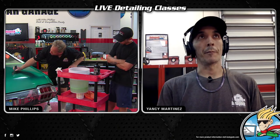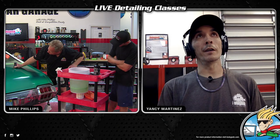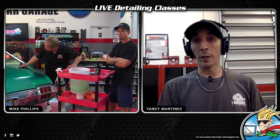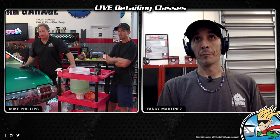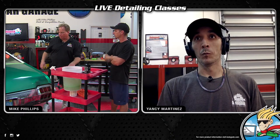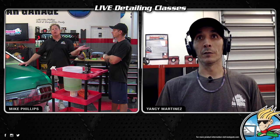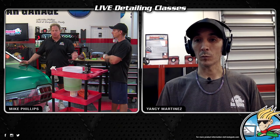8.1, 8.7, 10.2. Well, let's put it this way. If the average clear coat is 2 mils at the minimum. Minimum. All right. So if you measure your paint and it's at 4 or 3.7, I would not wet sand that. My general rule of thumb in the past is if a paint job is thinner than 4 mils, I didn't want to get aggressive no matter what I was doing. Yeah, exactly. So just a general rule of thumb.